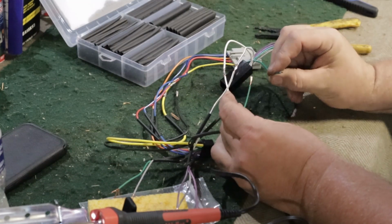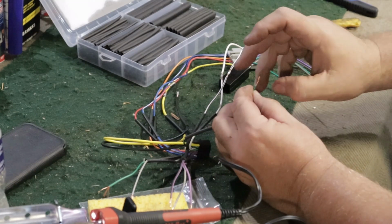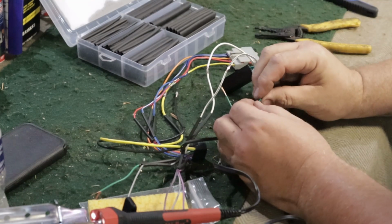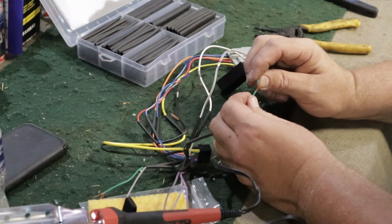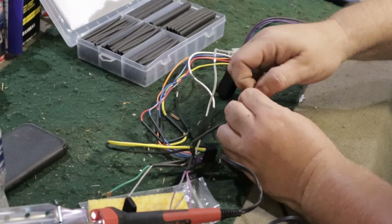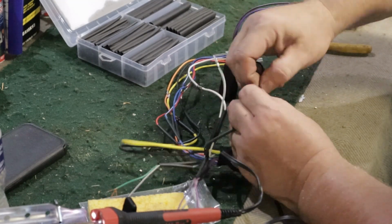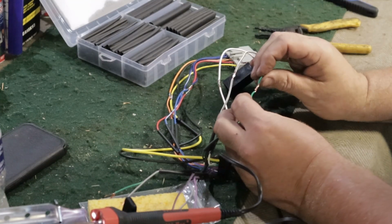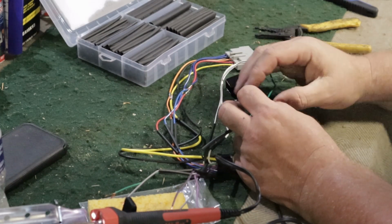Basically, your two wires, strip them back around the same distance, a little quarter-inch, maybe a little bit more than a quarter-inch. And I fan out the strands a little bit, both sides. And then I kind of lace them between each other. And then you twist them together. They should be kind of interlaced so you can't quite pull them apart. That's what you want.